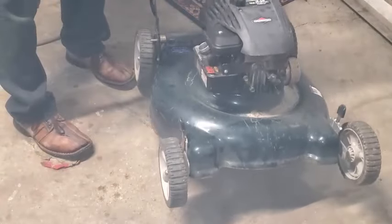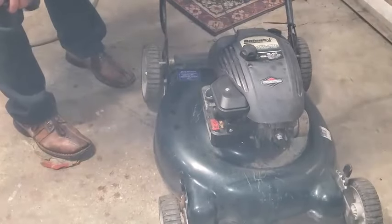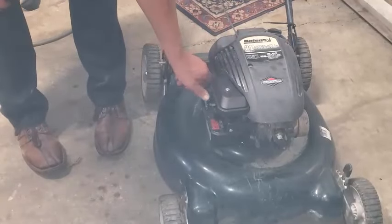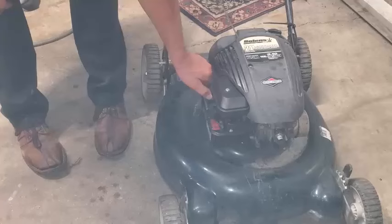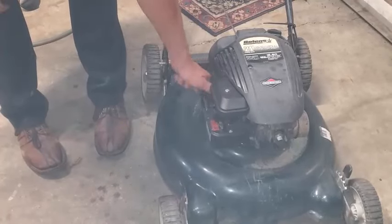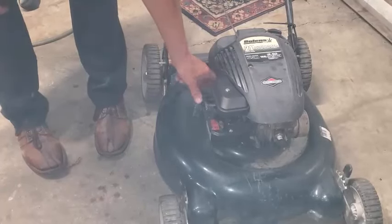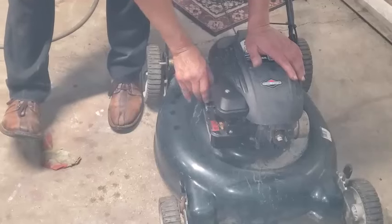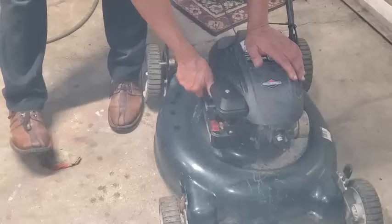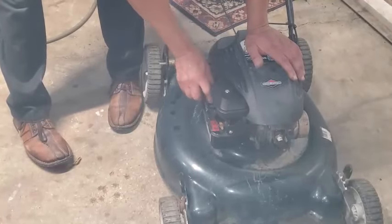I'm kind of looking down in there, looking to see for any water, water bubbles. I don't see any water in there anymore. Yeah, it's just kind of odd. It seems like a timing issue almost, a little bit. When I started to increase the RPM, it started misfiring. And I don't know. I think it's got some valve issues. Probably needs some valve adjustment,